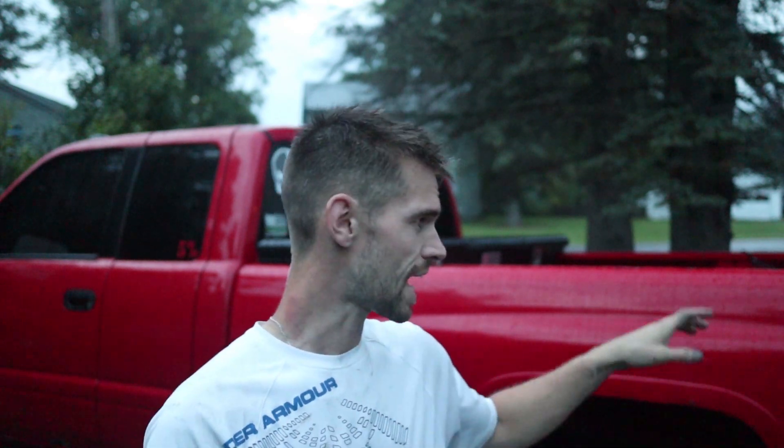I went with the VHT Nightshades tail light tint spray again, but this time I really laid it on thick for the third brake light, because it was just a white light color. I'm in the clear coat stages right now, laying on coats of clear coat. We're letting coat number three dry, and I'm going to do about seven or eight more coats. Then we'll go through wet sanding with 800, 1000, and 2000 grit — the same steps as before.